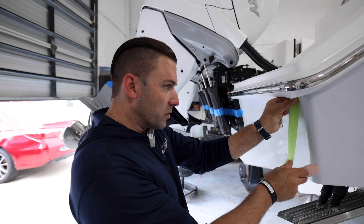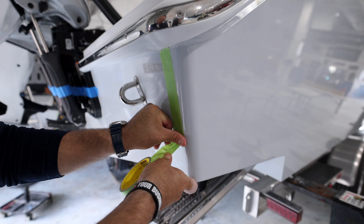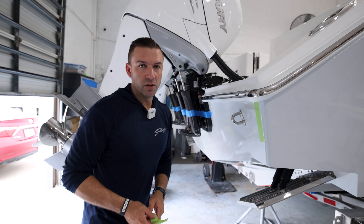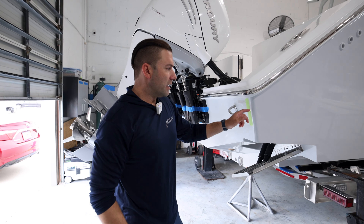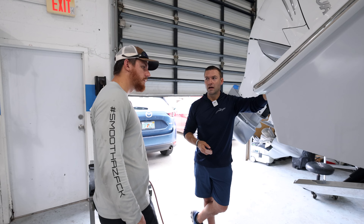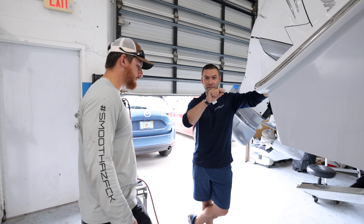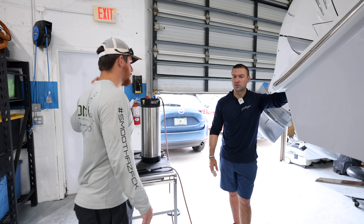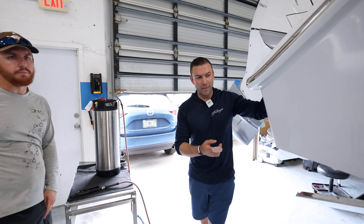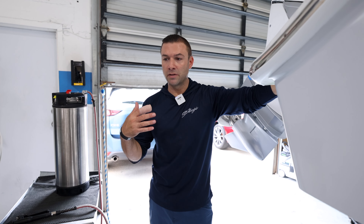We're going to put on our end barrier — this is where our line is going to be cut so we have a nice straight line and know where we're going. We'll make it match exactly the other side, squeegeeing the film right out to this edge, then cut for a clean line. On darker colors the waterline is easy to see; on lighter colors it might be good to match the line from our bottom coating to have a guiding line for the final trim.